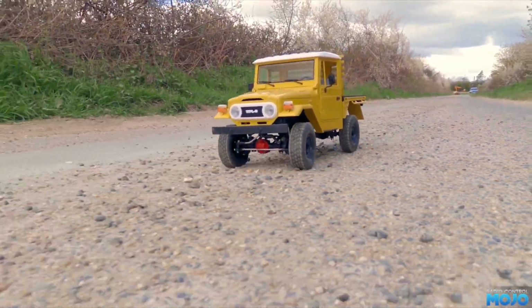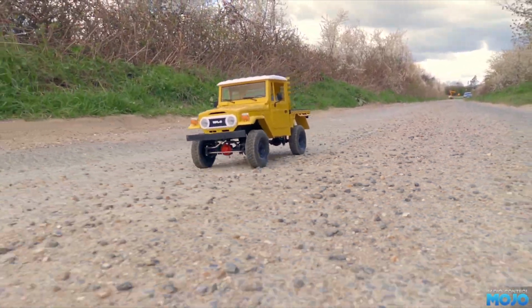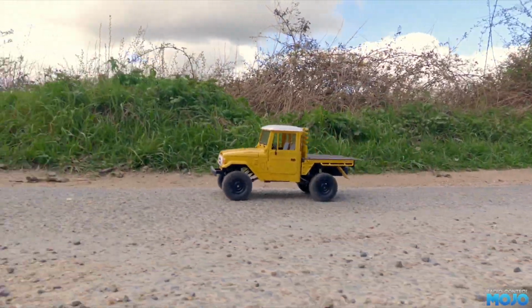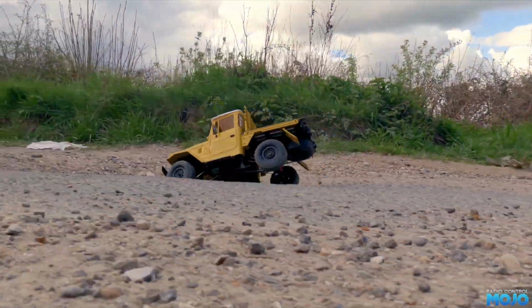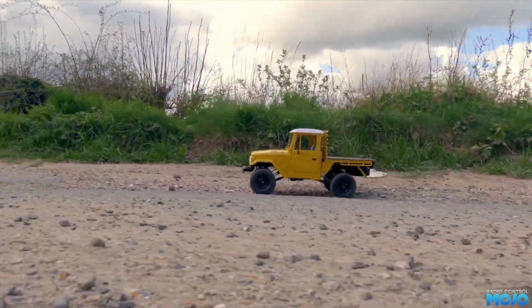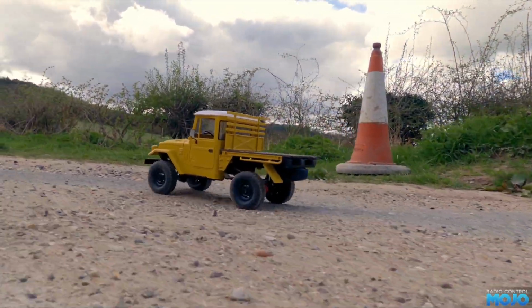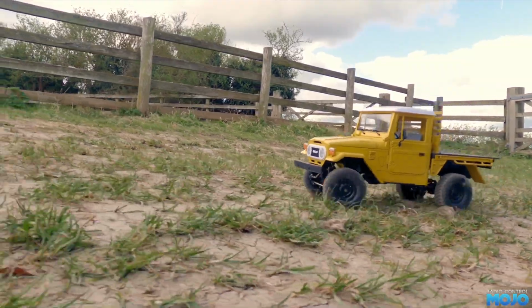For the first couple of minutes there was this little slightly alarming sound coming from the axles, but it didn't last long though, so it was most likely just a bit of chattering while the grease found its way around. It's not at all uncommon either. I always recommend driving trucks fairly slowly for a minute after a fresh build, RTR trucks too, just to make sure that wherever the grease is, it's going to get well spread around.